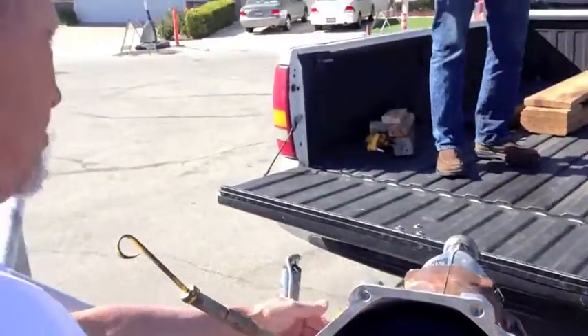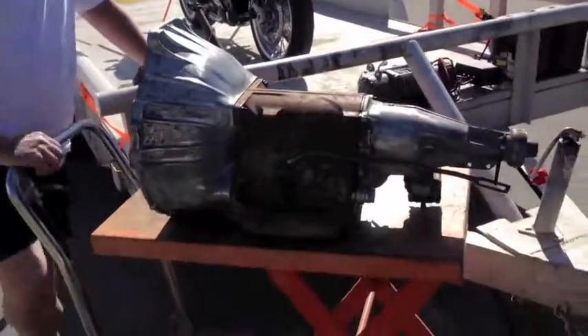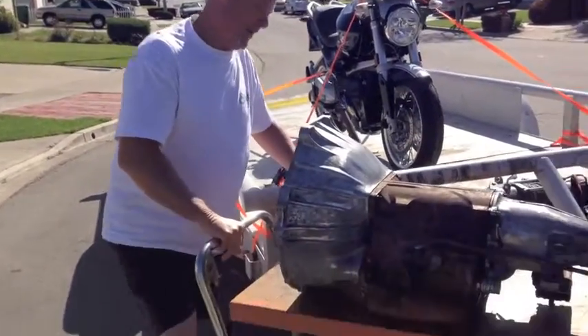They come in like this because it's a steel tube on an iron case — they literally just rust together. I have a special tool I use; I drive them out from the bottom side so I don't flare the tube. This is Dana's third FMX transmission he's done for us.